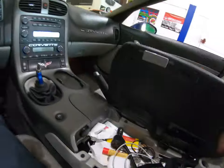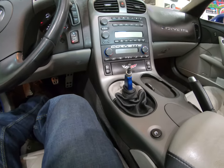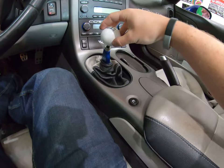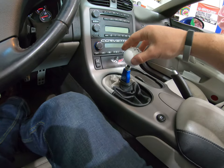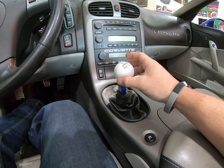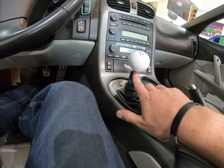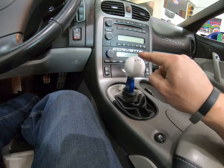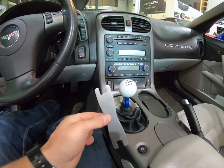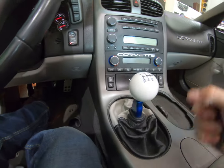Now that these Torx are back in, close that up. Last thing to do is put the shift ball on. So he went with the flat stick and a white shift ball instead of reusing the factory one. They say you have to be very careful putting this on — you're going to screw it on all the way, just loosely, until it stops. Turn it out one full turn, and then stop there. Now use the supplied tool to tighten up that lock nut on the bottom. If you over-tighten this and try to make it flat, you're going to crack the ball. So just tighten it with the supplied tool and you're done.